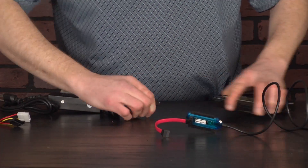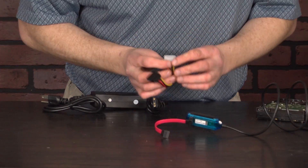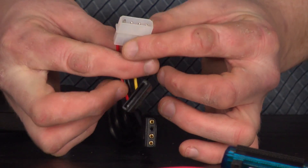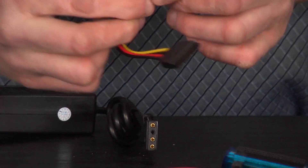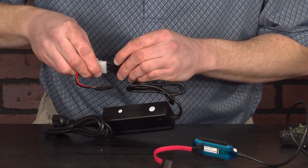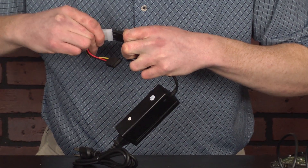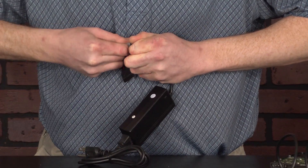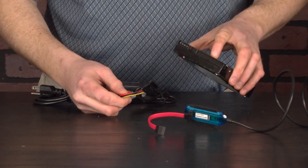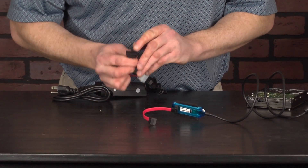We would take the hard drive's power connector if it was a desktop drive, take the Molex end of that power connector and connect these two. Now a little trick here — these move. Every one of these cables is tied into one of those prongs, so sometimes you kind of have to line up the cable and make sure all those cables are nice and straight to get the prongs to match for the Molex connector. This can take a little bit of force, and you kind of have to go back and forth sometimes. We've gotten the connector together and we would plug this side into the hard drive that has a SATA connector on it. The SATA connectors are just lines or rows of gold contacts — this will be for the power side, this will be for the data side.